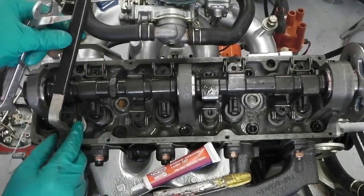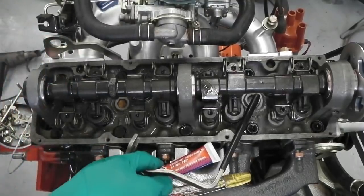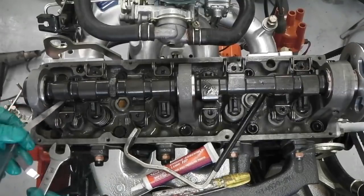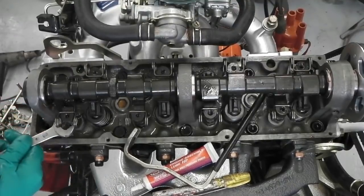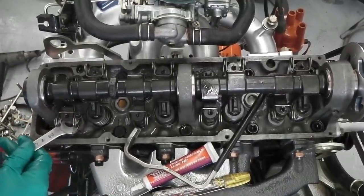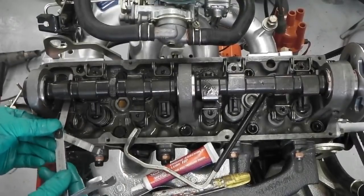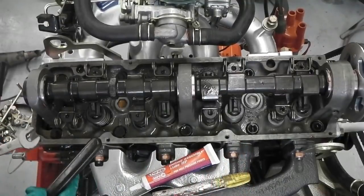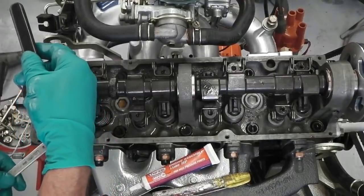As you turn and lock the, I've just remembered, you learn as you go. As you turn and lock, it'll try and readjust itself and mess up all your hard work. So you've got to hold the 15 in on some of them. They don't always turn together, but sometimes it'll drag the ball stud with it. That's just nipping it, so that's okay. I'll have to hold this now and then lock that. Otherwise, the whole lot tries to turn and you mess your clearance up.